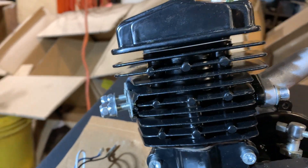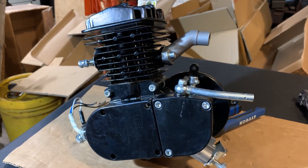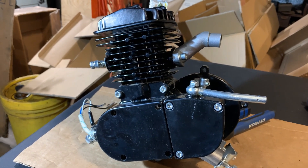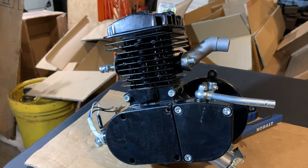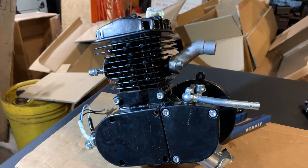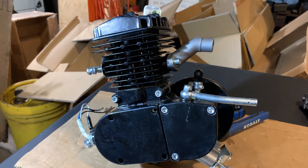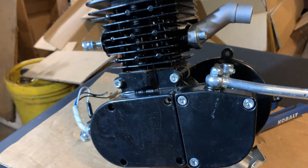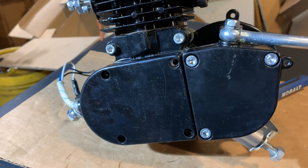It's not the vibration that makes your exhaust pipe loose from brand new — it's the shrinking of the exhaust gasket on the front. Anyway, back to the main issue: this person was riding down the street and the motor just locked up out of the blue. Didn't run differently, nothing. He said he was lucky he had a good grip on the handlebars. That's why I always wonder why guys want to ride their motorized bikes at 50 miles an hour — mechanical failures can happen and send you right to the hospital.